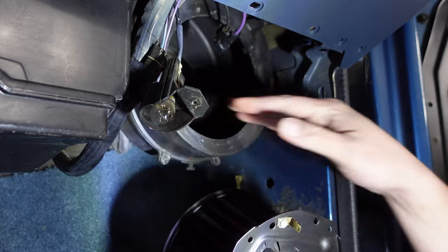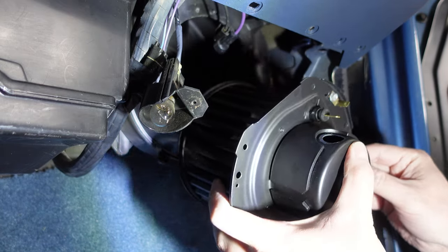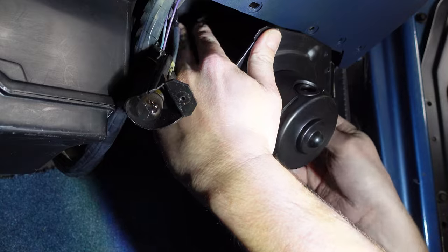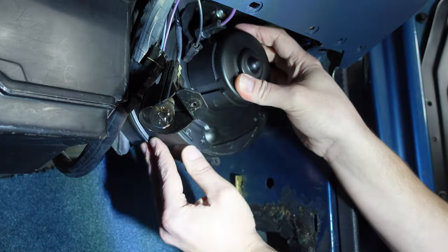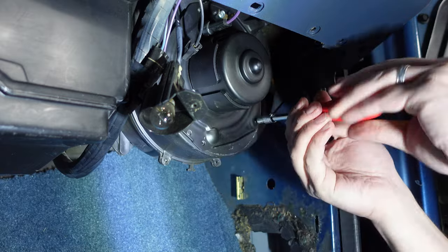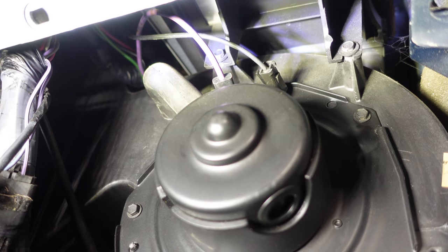We took some time to clean out the old air box. We also transferred over the ground connection to the new motor and removed the grommet where the vent tube will connect. If we have the plugs towards the bottom it gives us the most clearance at the top. Now we'll slide the new motor in. Now that we have the motor in place we'll go ahead and install the screws. After mounting the motor, reconnect the ground wire, the power wire, and the cooling tube.